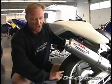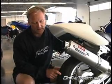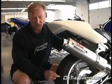And so a cold tear pattern goes the other way? A cold tear pattern looks like a fingernail shape. It's a half moon, and it will cut immediately up to 1 millimeter into the tire within 10 minutes. And hopefully we can find a cold tear here today and look at that. But these are two completely different wear patterns.